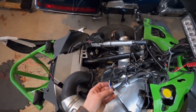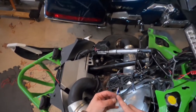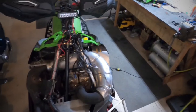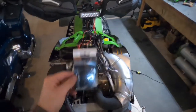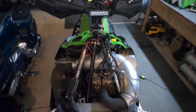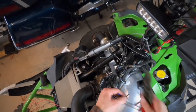I'm going to unplug that switch right from here. My constant wire is the white on this one. The blue is the positive wire and the black is the ground when the switch is on — that's what I'm going to splice into so those lights turn on. As a precaution, I'm going to add one of these fuses right from where I'm tying in, so that if any wiring goes bad between the tie-in point and the lights, it'll pop that fuse. Now we'll strip these wires back.